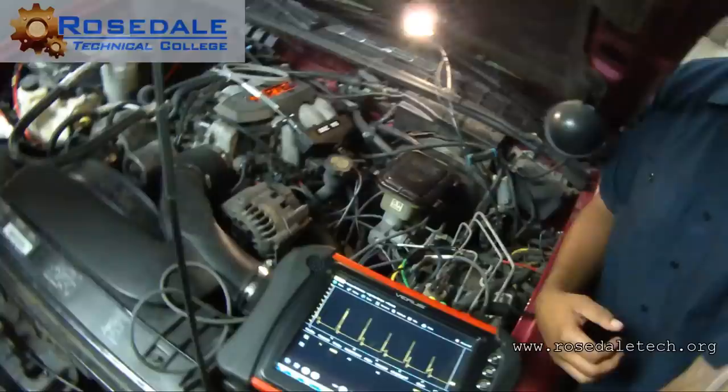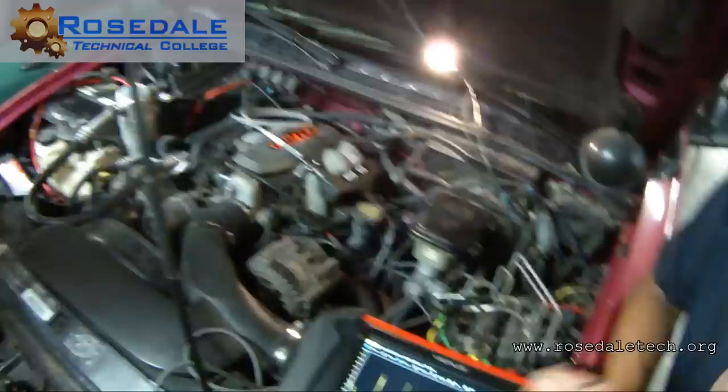All right, you see this real goofy looking firing and spark line? This would be the energy release in the coil before the current starts to flow. Just to give you an example, that right there is about 12,000 volts. And that's the release. And then the rest of this is the current traveling across the spark plug. And you look at that guy right there. That is either a plug wire, a plug, or a distributor cap problem.